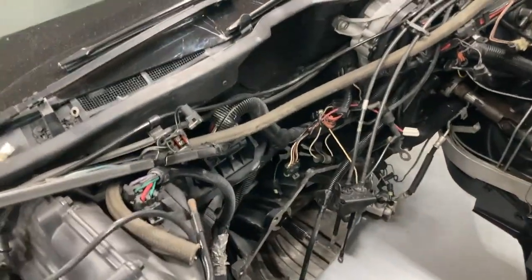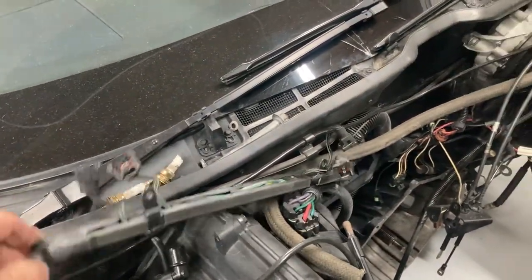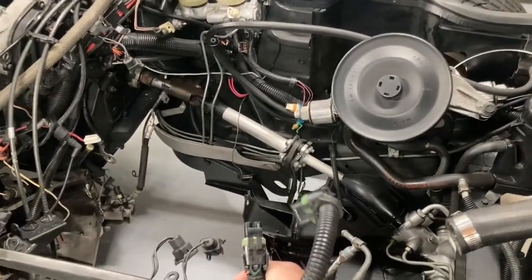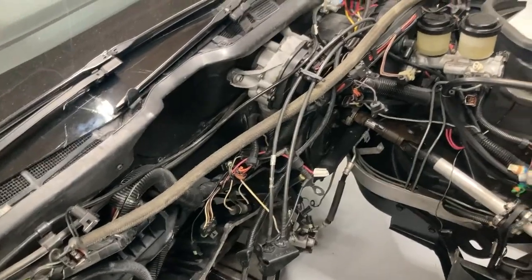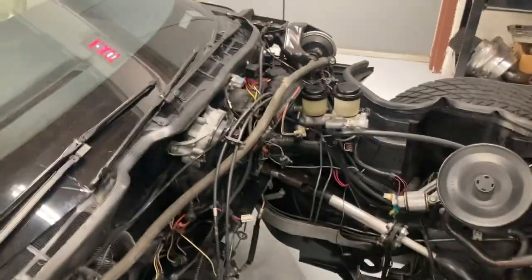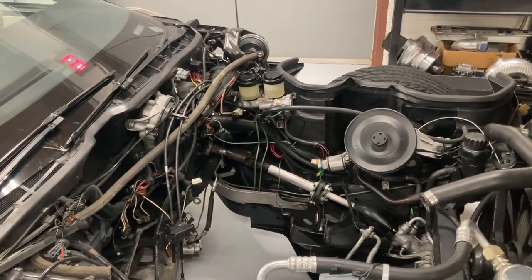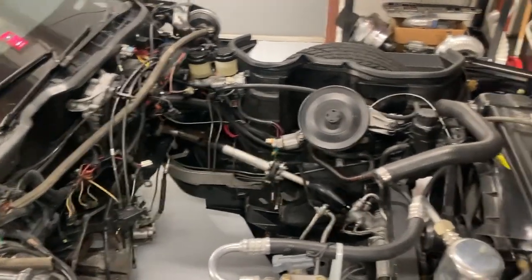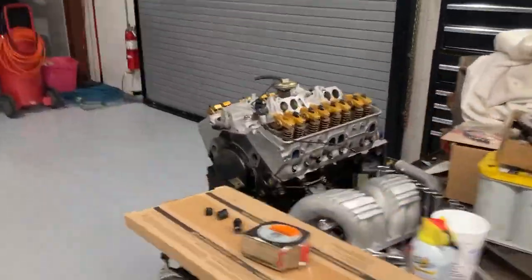All of that together is what it looks like — it looks like a mess right now, but it's not. All this is your injector wiring and it all comes down — that's why some of this stuff has to go under that plenum first. You can't really put the stuff together until you put the car in and assemble it one piece at a time. You can snake those wires under the intake, but it's really easier just to do it in the car. As many times as I've done motors on these, it's best to just put it in this way and assemble everything in the car.